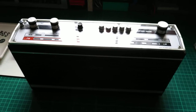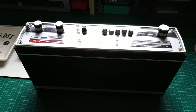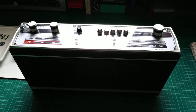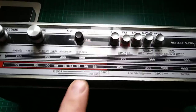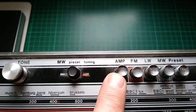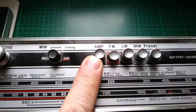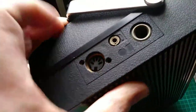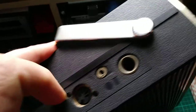It's actually one of the first FM radios I ever bought. It's actually one of the reasons why I never bought a Roberts or a Hacker radio at the time — there was just a little feature on this which I was quite interested in, which is this little button here marked 'AMP'. Basically this just disconnects the tuner section and allows you to use the audio stages from the socket on here.